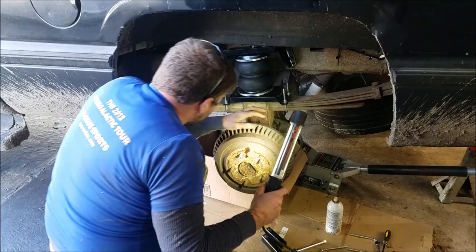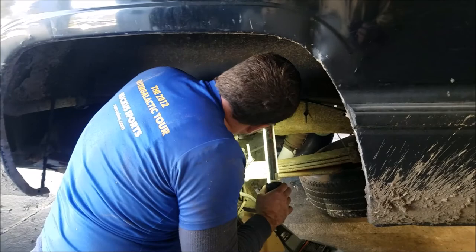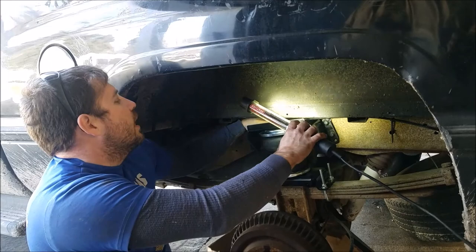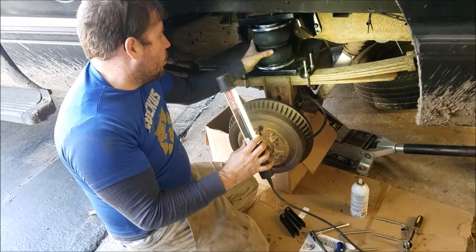We got the spacers. I had to use two because this is a Dodge — one up top, none anywhere else. The spacers are a bit of a pain if you've got a Dodge with that frame indentation. Got everything in. Tighten these down real good. Make sure after you get it done to tighten the bolts on top and bottom that hold the airbag in place so the bag will be where it needs to be.